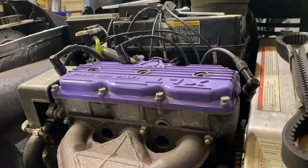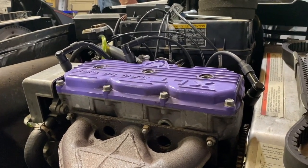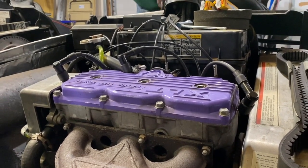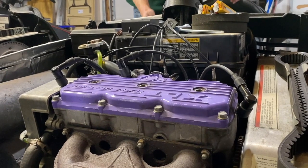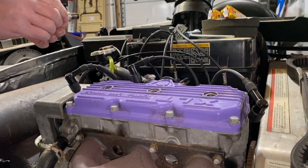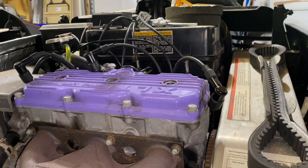This might seem a little strange, to pull this over with no plugs in it. It's the same with dirt bikes too, if you follow them on two-stroke motors. But it doesn't hurt to just give them a couple of pulls. When you put something in storage, there can be extra oil in there, so it's good to make sure you get rid of it.